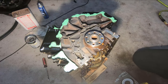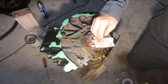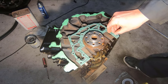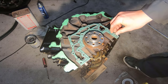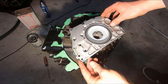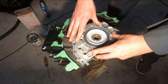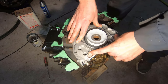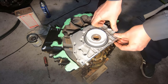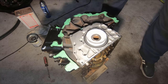With that painted up, I'm going to go ahead and replace that rear main seal, just cleaning the mating surface for the flange that holds the seal. I'm using acetone because it dries really quickly and makes sure the surface is clean so there won't be any grease that'll cause a leak later. You do want to be careful with your selection of rear main seal because there are a couple of different styles. This one has a layer of teflon on the inside edge, so it has to go on dry. But if you have a different style you may have to put a little bit of lubricant on, so just make sure you read the information that comes with the seal you purchase.